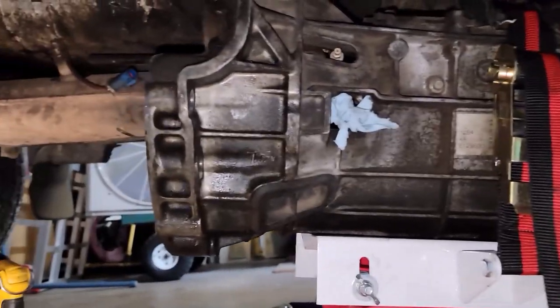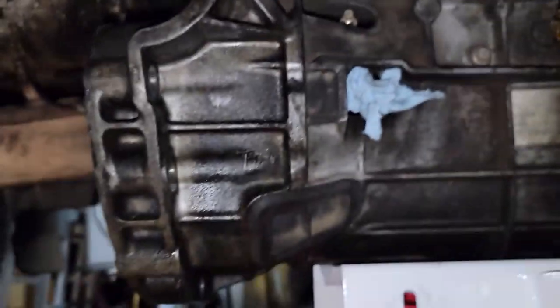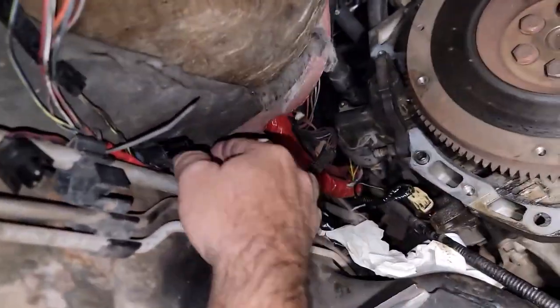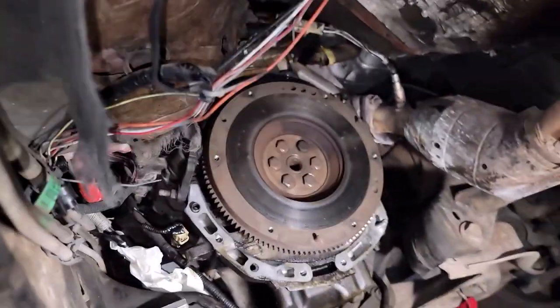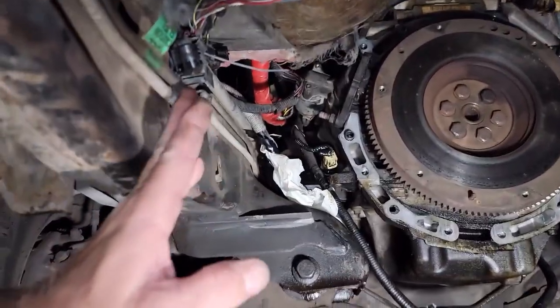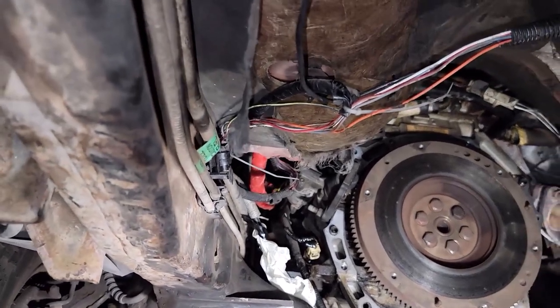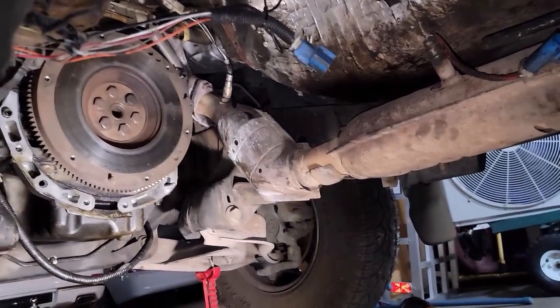This is the hydraulic connection, and this is the other one — I have a glove around it taped on. Also, the other thing that's probably warning us — though I might hold off on it — is I noticed we've got that jiggle going on in the speedometer. Either the wire connection is screwed or the sensor is screwed. I think it's the sensor because somebody kind of RTV'd the connector on, so it's probably not making a good connection. I'll wait till we get a new output shaft sensor.